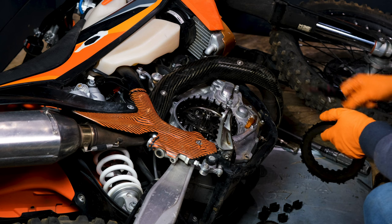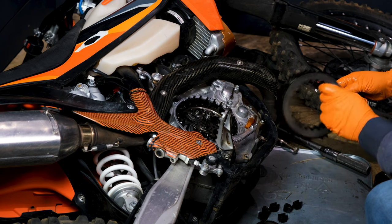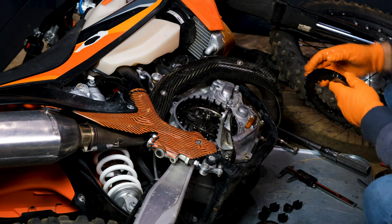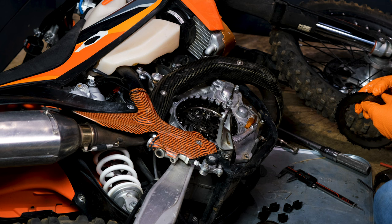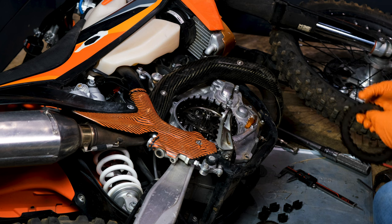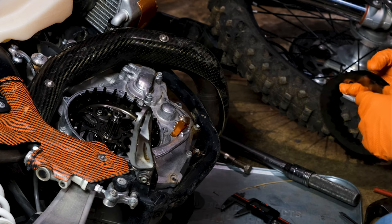The stack height is actually substantially different — wasn't really expecting that. That's interesting. I also wanted to count the stock plates. There are eight friction plates in the stock setup. In the new Recluse clutch there are nine friction plates, so there's an extra friction plate.